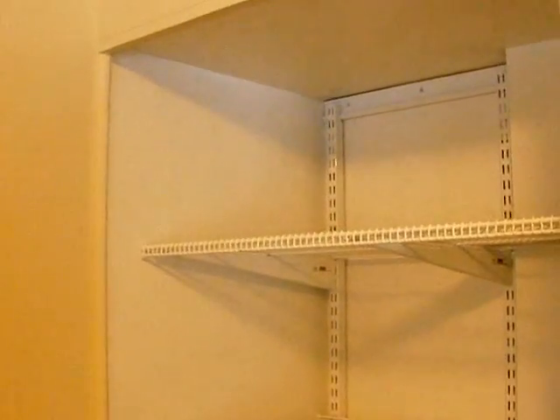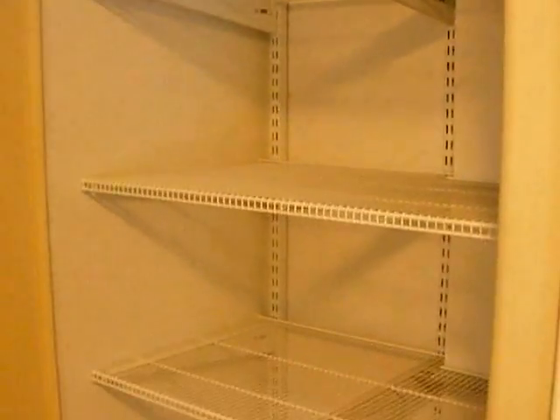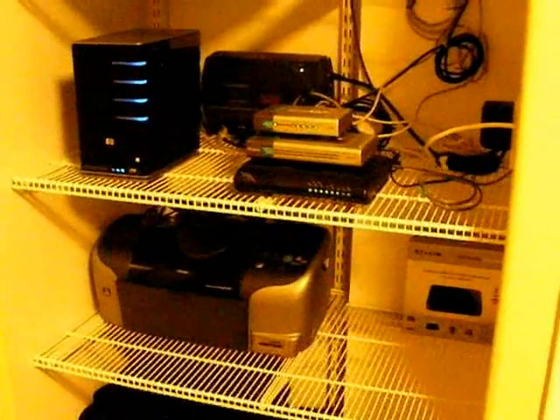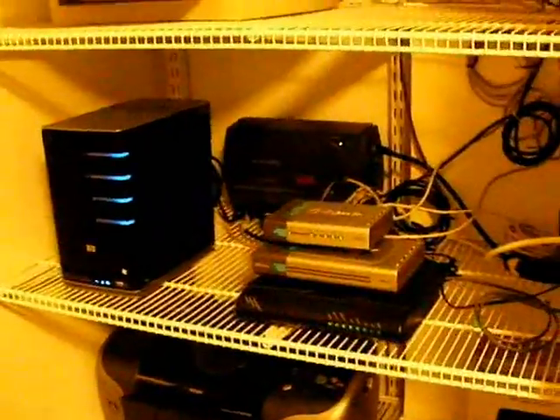The inside is painted white semi-gloss to cut down on dust. Here is the finished product with some floor storage and some USB devices on the second level. On the third level we have our cable modem, which is backhauled into the phone system for cable phone service, our router, another Ethernet switch, and our HP home server. All of those devices are served by a UPS to get through the 15 seconds needed for the natural gas generator to start. Up on the next level is our printer — we have a JetDirect Ethernet print adapter for that, and we also have a Belkin USB print server that we might experiment with. At the top, we have our wireless access point.